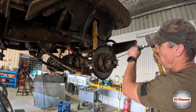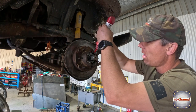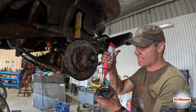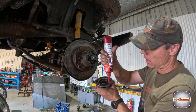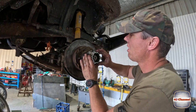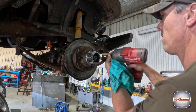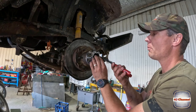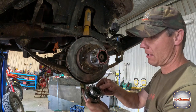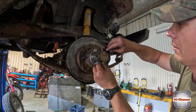Now we need to put the freewheeling hub on. We're just going to put the gasket on — put our gasket glue on, then our gasket and the gasket sealant straight onto the hub. We've got our two dowel pins, so we're going to line those dowel pins up, drop that in place. Cone washers and nuts — we'll do all that up. Our retainer ring, so just get our circlip pliers. Can our gasket sealant, our new gasket, and we'll do up our little bolts.